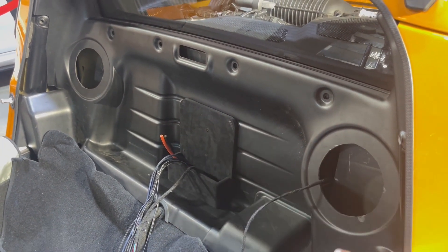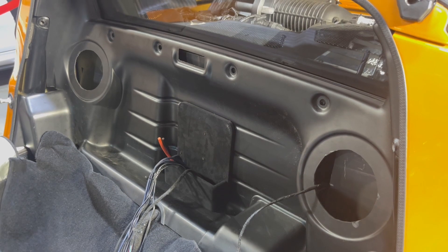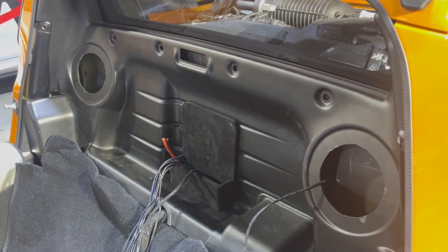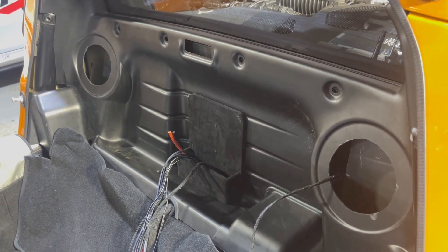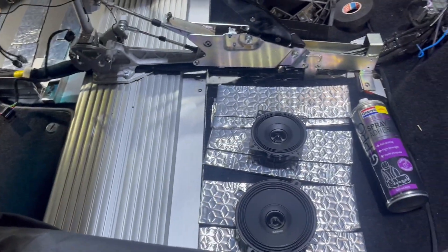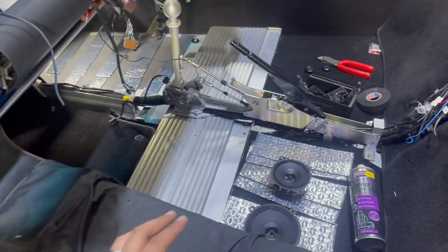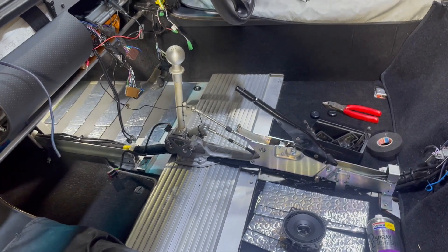One really important thing: this plastic panel is incredibly flimsy, so we've supported it using Skins 3mm soundproofing. We've applied acoustic deadening to all of the behind-the-scenes area, which builds a better acoustic environment for the new speakers. With a lot more power going to the system from the four-channel amplifier, there will be many more sound waves bouncing around, so we needed the best acoustic environment possible. We've also laid the footwell and base of the vehicle with soundproofing strips, reducing road noise, rattles, and resonation.